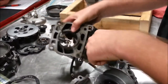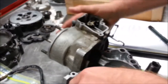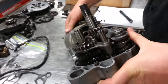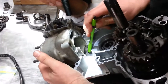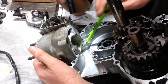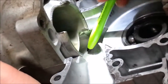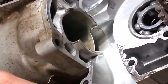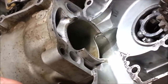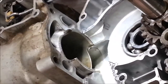The other thing we do is take our cylinder without a piston in it. Do you see how this has dowel pins? This is the easy one to do because it already has dowel pins from the manufacturer. I would torque this with gaskets, and do you see that rough edge? See how the airflow can't get across there? Then you put a gasket in there — extremely turbulent. So I come in with my porting tool, grind that, and smooth the transition so that the air-fuel charge can go from one area right on up to the next. This is called case matching — it matches the case to the cylinder.